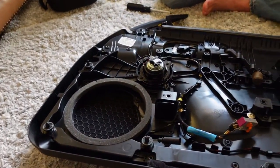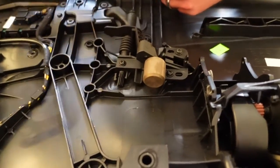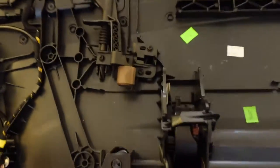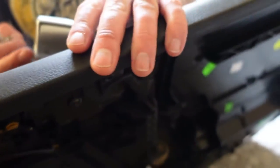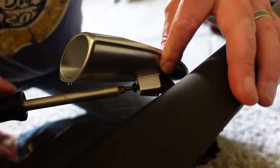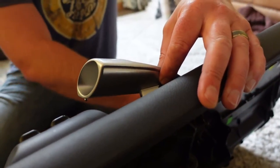This is finally something we need to do on the inside. Porsche things — everything's in pieces the further you go. But if you look right here, this somehow breaks. I'm not really sure how it breaks, but this one's not broken. So we're going to put this in here. To get this door handle out, there's a T20 screw. And then this should slide out. Look at that — and you throw the old one away. Just kidding, you do need it for reference.